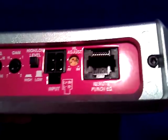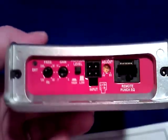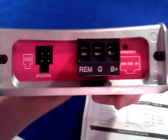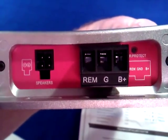You can also add the optional remote Punch EQ dash mount control to this piece as well. For those guys out there using it for a factory stereo installation — just adding some bass to your system — this is definitely up your alley, as you don't have a subwoofer control or RCA outputs from your factory radio. It gives you a lot more ability to control it all and utilize it to its full potential without cutting the bass out of your other speakers in the system.